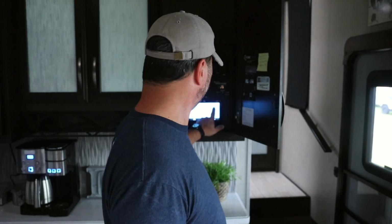Those were all the lights we had on, and we're still drawing about 15 amps. That was about 9 amps, all that stuff. Turn that stuff back on. The bottom line is, I know exactly what's going into or out of the batteries. I know exactly how long it's gonna last based on that current load, and I know exactly how many amp hours I have left. So it's really, really cool to have that information.